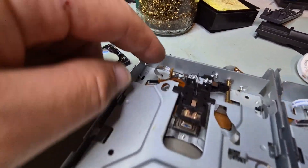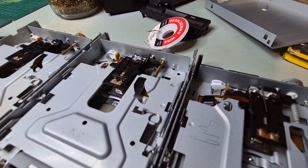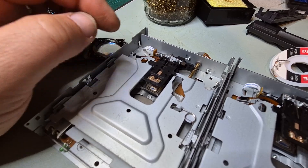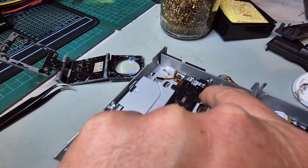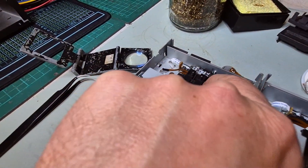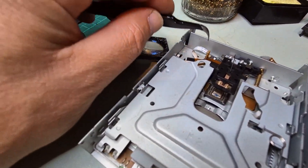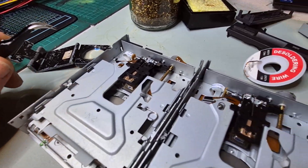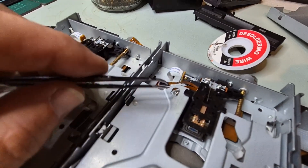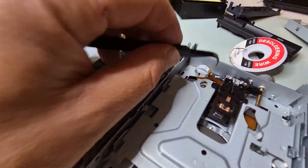Do not touch any of these guys like this here — everything is aligned perfectly. So we certainly don't want to disturb the alignment. Because if you see here, this is a little optocoupler here. And what this does is it helps aligning with track zero on the disc. So if we move this even so slightly, we could change the position of track zero and we'll have to do a whole lot of calibration. It's feasible, it's just painful. Don't touch this unless you have to.